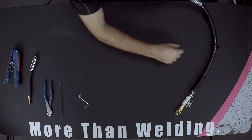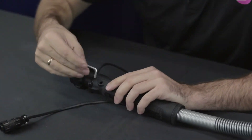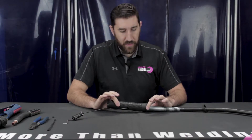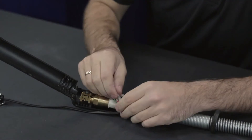Removing the cable from the back end is a very similar process. There's a little plug right here — remove it, take your allen key, quarter turn to the left. There's a support nut again at the base, then open the rear housing, disconnect the leads, and remove the cable from the rear housing.